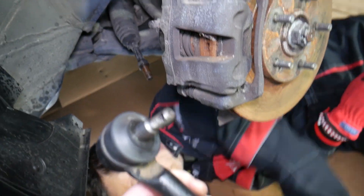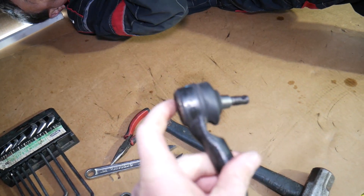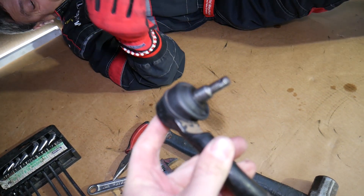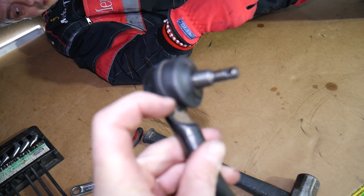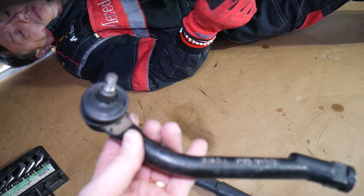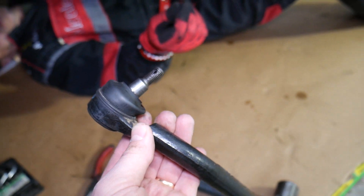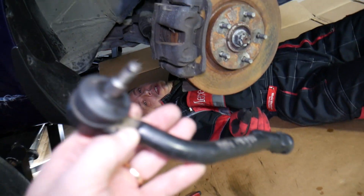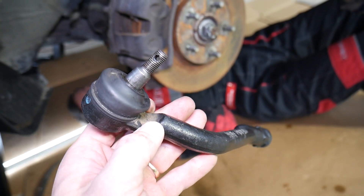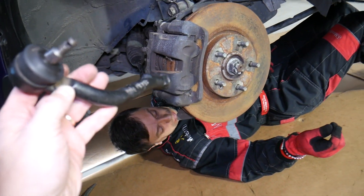When you install it and get that nut tight — if it starts spinning again, support it on the bottom with the jack so the bolt gets stuck and won't spin. But make sure the car doesn't fall on you — that's super easy to happen. Always support the car with multiple jack stands and try not to lay underneath it. Hopefully the video will be helpful. Thank you for watching and see you guys next time.